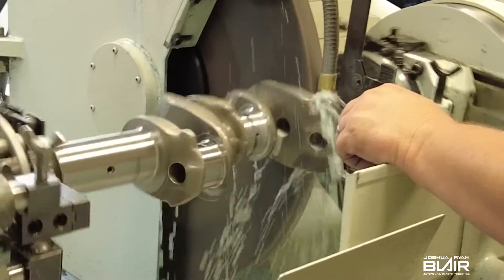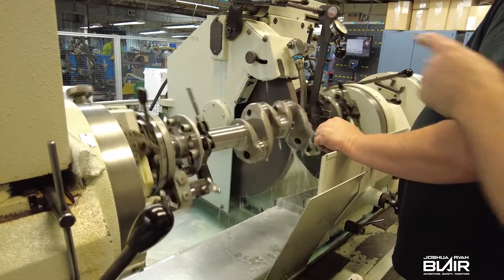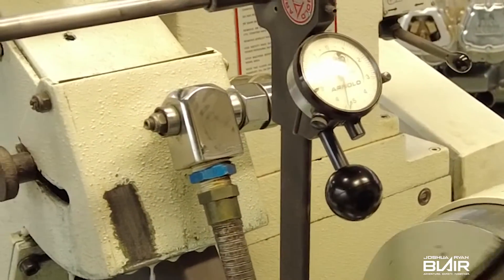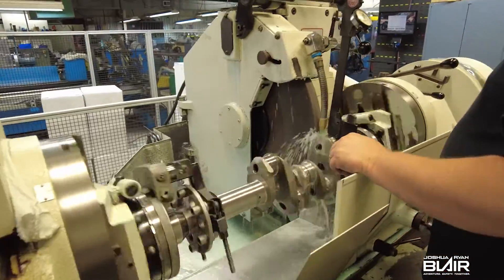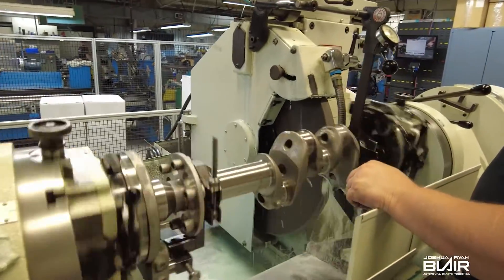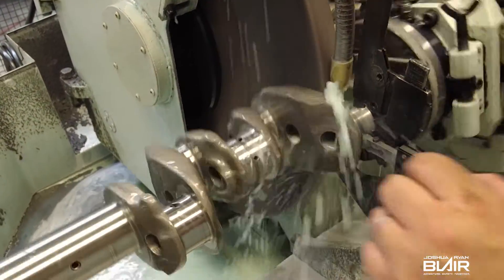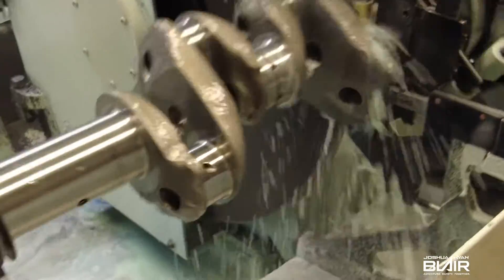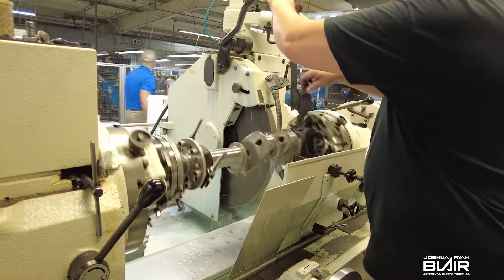So what crank is this? Off a 360. You can see right here — if you take the rod to 10 under you can see the wear in it right here, and he'll take that wear out. When you get a lot of that wear out, the tool will touch off on the journal and then on the steady rest it'll start feeding in with pressure, getting the highs right out of it. You want them as true as you can get them because of wear on the bearings and on the journal itself.